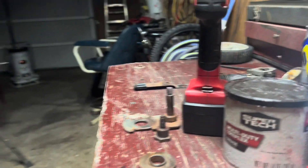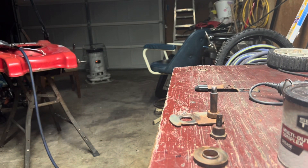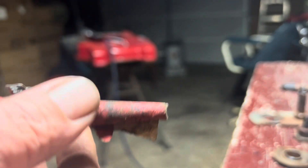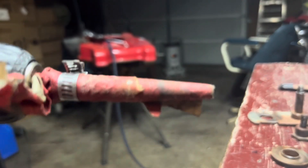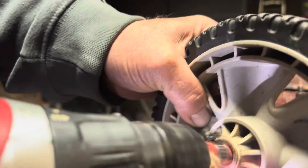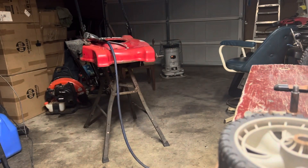Another little trick I came up with today while I was just sitting here daydreaming. I'm always talking about cleaning up the wheels with the steel bushings and everything. Well here's my little tip for today: I actually have a wire wheel that goes on the drill that'll work perfect, but this is just an old piece of threaded rod — throw a piece of sandpaper on there, run it through your wheel like such. That's really all it takes to do that.